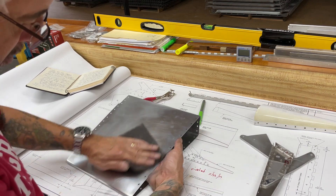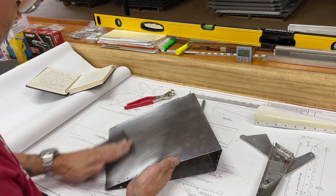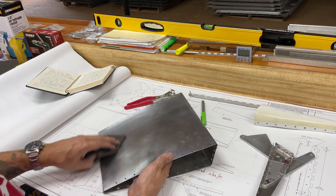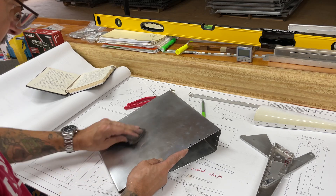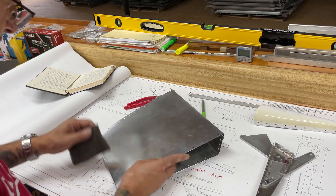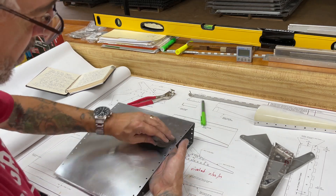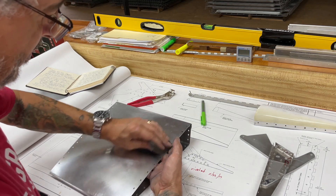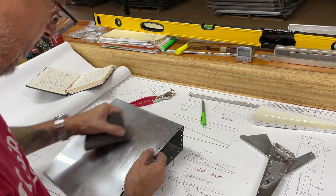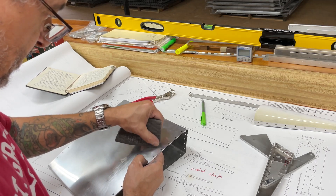What I'm doing here is using some fine Scotch-Brite pads to try and remove some of the polish on the parts that Steven had already done. I'll probably have to do this a few different times, but I at least want to focus on the areas where the rivets are once they're finally assembled. Then I can go back right up to the final point of painting and get a nice even scuffed surface along the entire aircraft. Then I believe it'll be some sort of epoxy primer, and I'll be using a single-stage paint to try and keep it simple — the base coat/clear coat thing just seems like a lot of extra hassle.